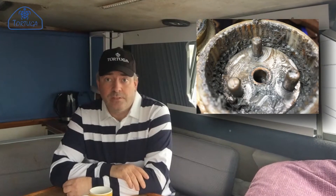Welcome back. So we found out why the starter motor was not engaging. Basically, it was stripped of all its internal gears and the engine was seized. The engine was seized because water was in it. Water was in it because the exhaust manifold gaskets had leaked.